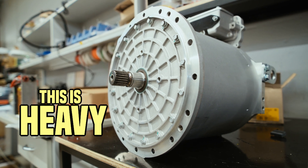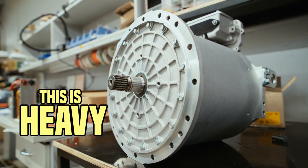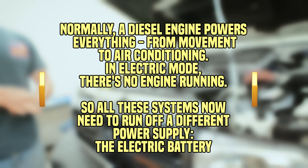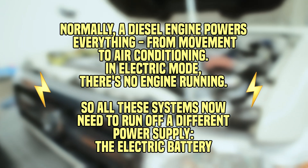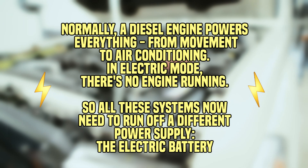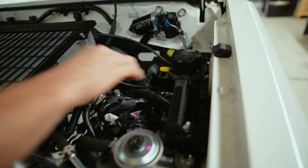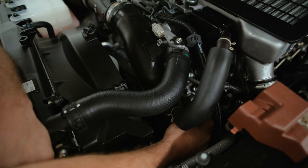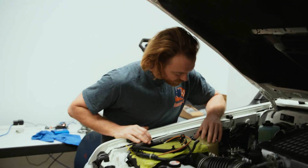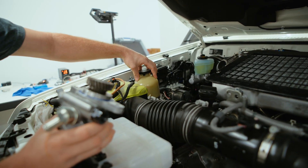There's a lot of headache having a hybrid vehicle. Anything that runs off the motor when it's in electric mode won't be spinning, so there are a few components that needed to be run off 12 volt. We've put in a third party vacuum pump to replace the stock one, as well as the steering pump which has been blanked off at the front of the motor.